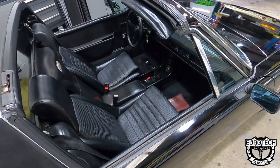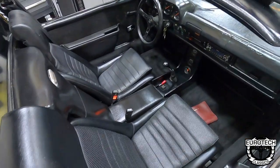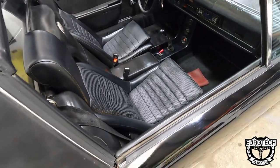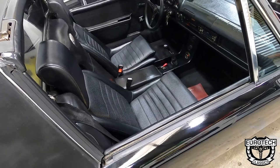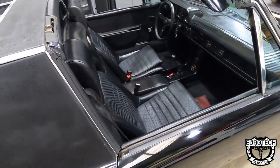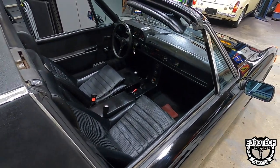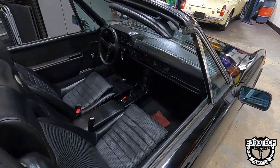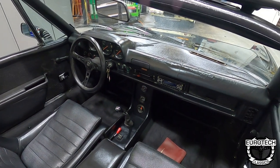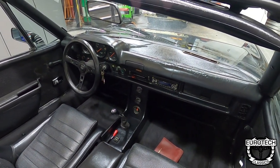With the top removed, you can see it's got two adjustable seats. The passenger adjustable seat came out right after 1972. Before that, you had a fixed passenger seat that was not adjustable. So that's an easy way to tell what year the car is if you're finding one. This one has the optional center console with three gauges, which is pretty neat.